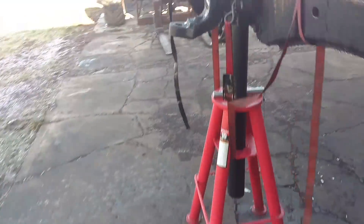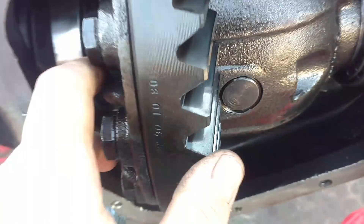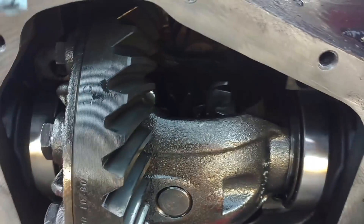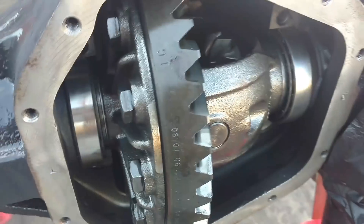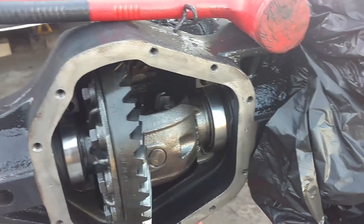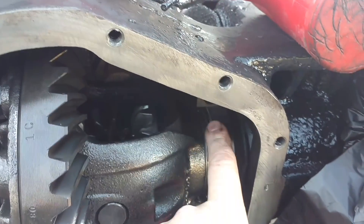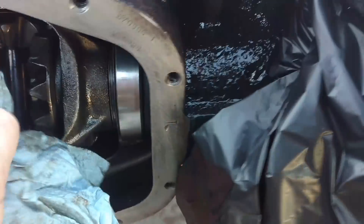We're gonna change out axle joints, change out ball joints, get everything on this axle back together and assembled. We got our rotors back — they've been turned and machined, all ready to go. When you go to put the carrier in, it's very important that your ring gear is meshed with your pinion before you start pushing it in. Once it's seated, I'll take a little dead blow and tap on the carrier lightly on the back side to get it in place. Then before I start tightening, I take a mirror and look back in there to make sure the bearing race is seated, make sure it's square and not cockeyed. You never want to hit the races or the bearing — if you put a ding in it, it'll wear out and bind up.